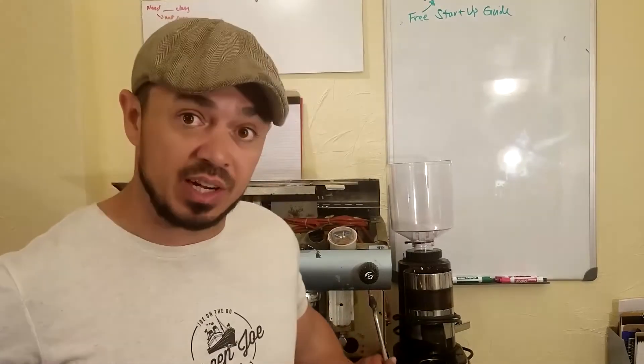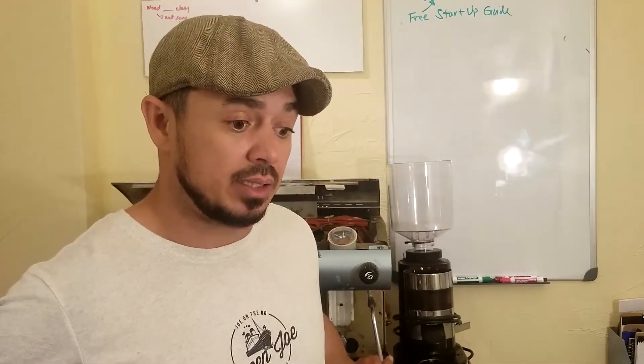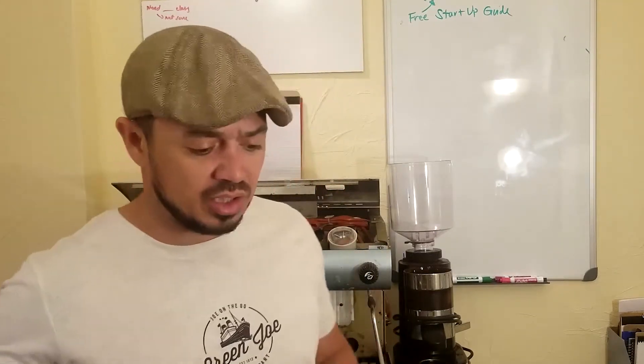There's an auto relay that your machine will automatically pump water into the boiler to prevent it from running dry — that didn't happen. My boiler ran dry and it cracked the heating element. I was not able to generate pressure. I could push the motor and pull water, but my steam pressure eventually dropped completely and there was nothing but cold water coming out of my shots — murky and blah. I had to take it in and diagnose the boiler system. The technician put electrodes to the back of the boiler and determined it wasn't getting electricity like it was supposed to, because the heating element was cracked in half. The circuit stopped being a circuit and it wasn't heating the water anymore.